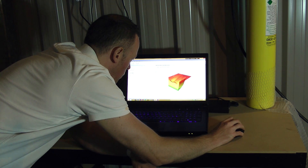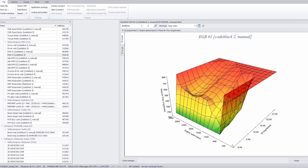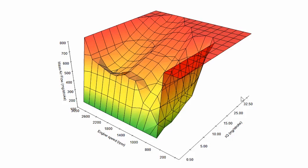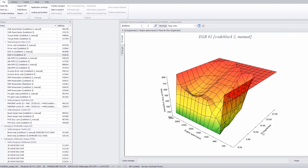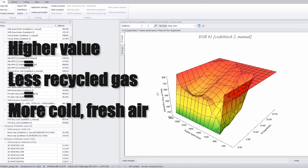What we're looking at here is a 3D representation of an EGR map. Engine speed is on this axis, airflow going through the engine on another, and finally the injected quantity of fuel being requested. When the engine is being sent full fuel delivery, there is no EGR valve turned on — that's what this flat section is at the top. Also, when there's very low RPM — stall conditions — there's no EGR being allowed to flow, because it wants pure cold air to keep the thing alive. At varying stages of low power demand and low RPM, there are different quantities of exhaust gas being recirculated. The higher the value on mass airflow in the map, the less EGR is allowed to pass into the engine.